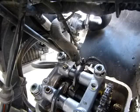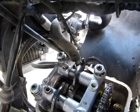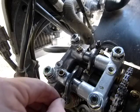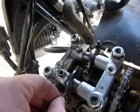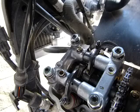You need to make sure the cam lobes are out of the way. Just pick a position on the camshaft so the cam lobes are out of the way. The radius of those cam lobes is pretty constant all the way around, so you can measure valve gaps in any of these positions. If I rotate more, there's still a gap. If I rotate the other way, there's still the same gap — because the cam lobes, for three quarters of their turn, have a pretty constant radius. You can measure the valve gaps in any position where the cam lobes are out of the way.